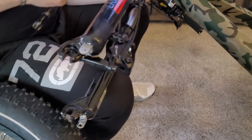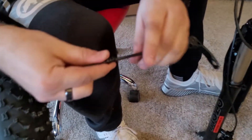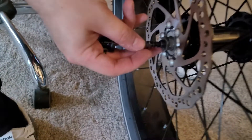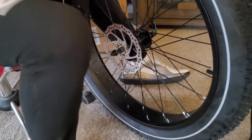Now we're going to start putting the tire on. We had to take off the little protective piece at the bottom of the forks. We're going to take our skewer, leave one spring on one end, and poke it through the axle. Take off the plastic guard for the rotor, put the skewer through, then put the other spring on — remember: small end of the spring inward and big end outward toward the nut. Go ahead and screw it on just a little bit so the forks will fit right in without sliding off the threads.